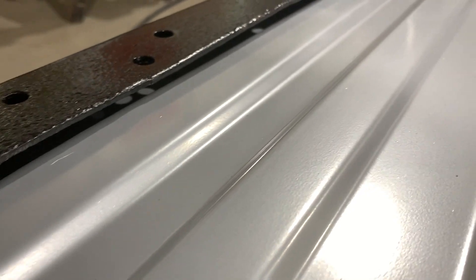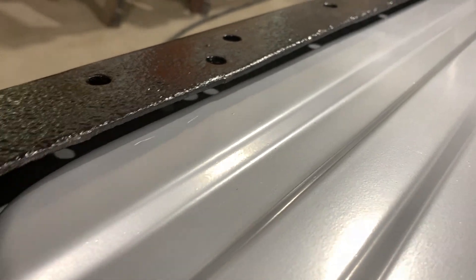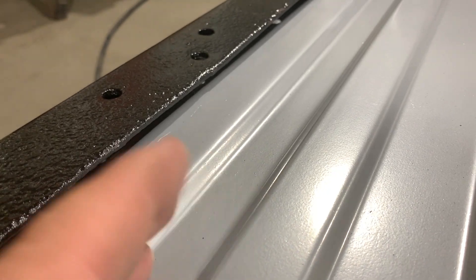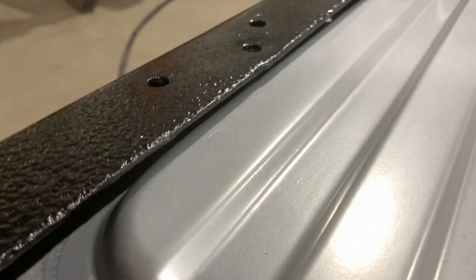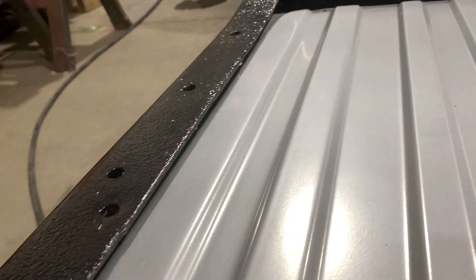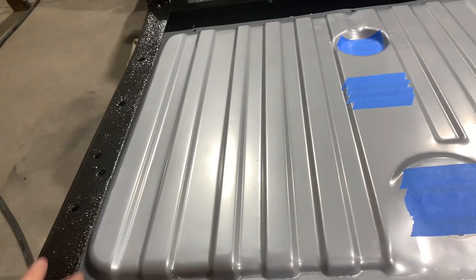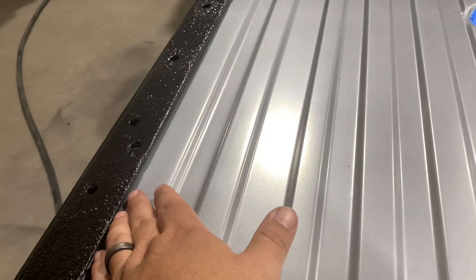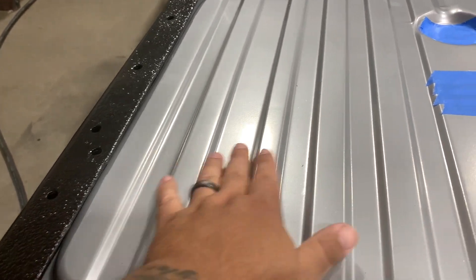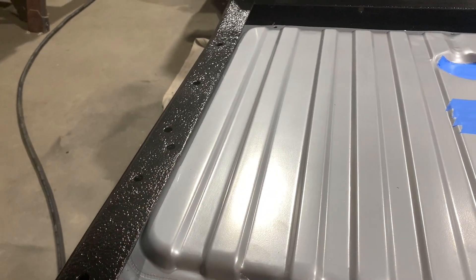I put a little painter's tape over the holes because of grinding dust. I left just the tiniest gap there — maybe about a quarter of an inch. There are going to be rubber strips on the rails, which will raise the tank height approximately an eighth of an inch, so that should be fine. I'm also thinking about using automotive weather stripping to seal that gap off so water from car washes or rain doesn't funnel in behind those rails and cause rot. We'll see if there's room for it.